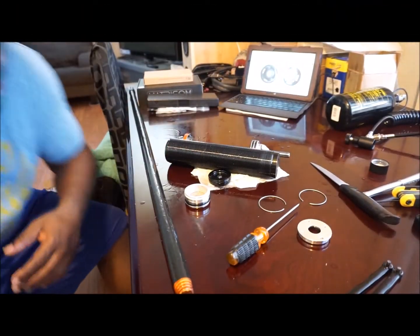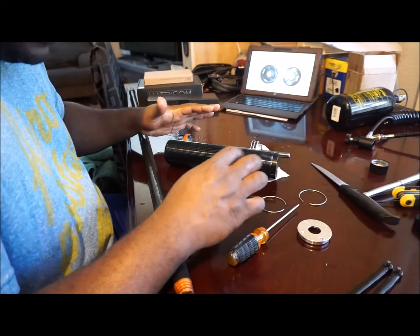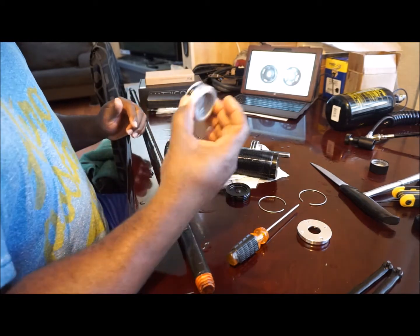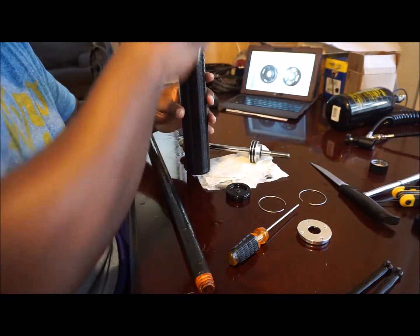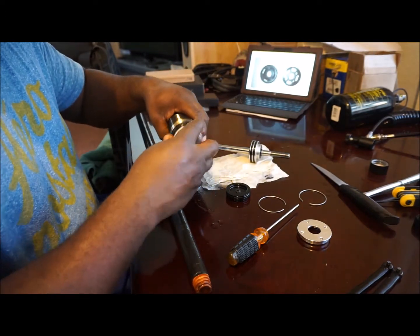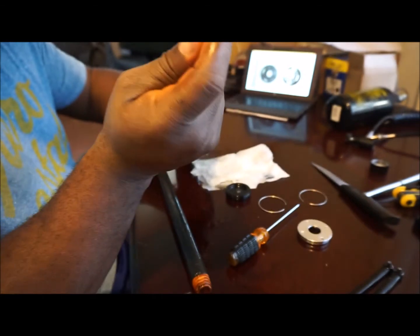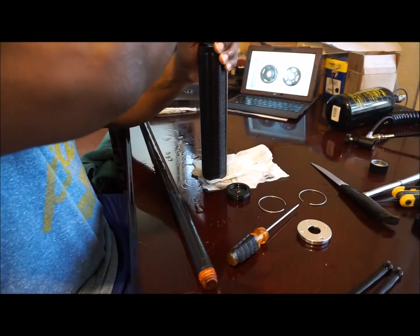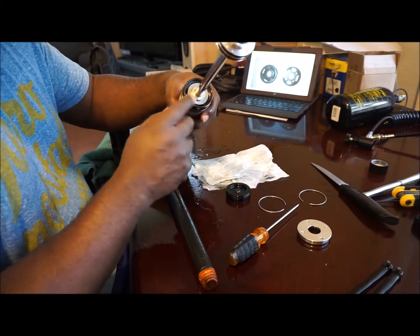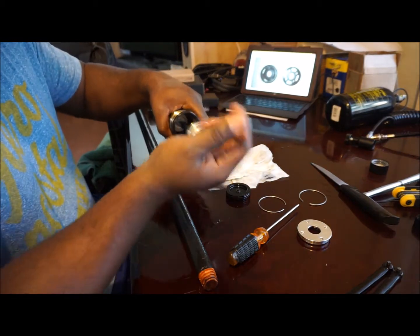So what I have here is my shock body, shock shaft, sliding slash dividing piston, and the shock butt plate. I'm going to show you how to piece this all back together. I also have a broomstick to help gauge the distance for this sliding piston. Stick the sliding piston in like so and tap it — we want it flat and flush. Take the shock shaft and push down on the piston to gauge where the sliding piston needs to be so it doesn't make contact with the bottom of the shock shaft as it operates.